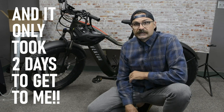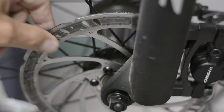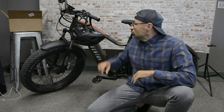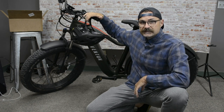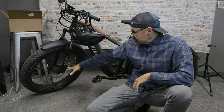I also want to say that part of the problem I was having — some of the noise — I do believe there was a residue that spilled on the disc. It was probably oil from the hydraulic brakes, and I think I'm going to have to still fill up this front brake a little bit more. I do think there was a leak. It still doesn't quite have the pressure I'd like compared to the rear brake, but I slapped the new pads and new discs on, did the bedding-in process, and they are performing so much better.